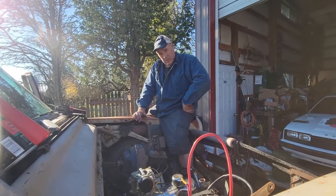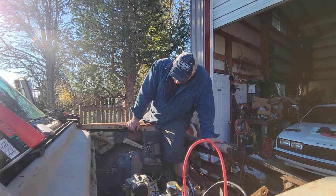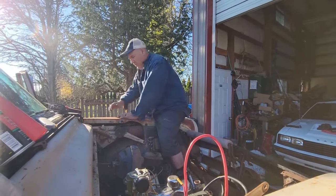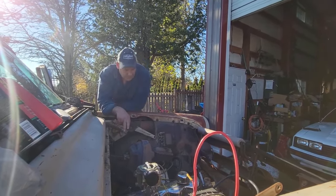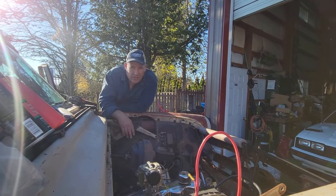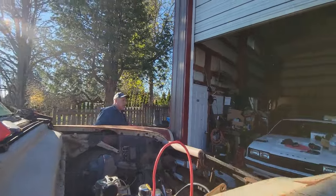Is this front wheel brakes? Yeah, it's all the wheel brakes. Front disc, rear drum, just like a Ford pickup. I'm going to get my tape and measure. We're going to measure the throw of the pedal. And then, see, what I need is this. I think the pedal hits the floor before this bottoms out, so I have to put some spacing in here to take up the bolts. Anyways, let me find my tape measure, and I'll give you instructions.